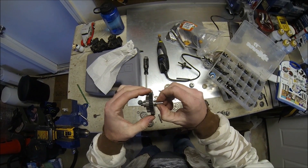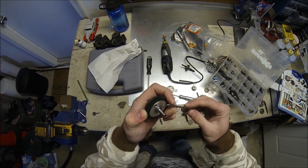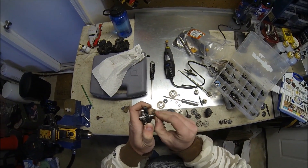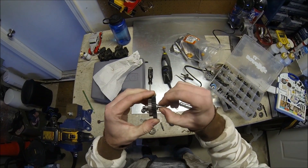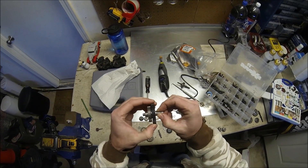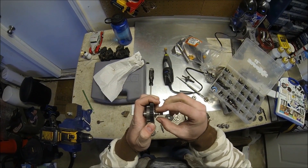With the shims in, it moves. So if I shave down this little lip to where it's even when you put your shims in there, it'll butt up flush with the gear. You want your transmission gears to not have all that slop in there — the stock trannies have a lot of slop. So I'm going to go ahead and machine that down real quick.